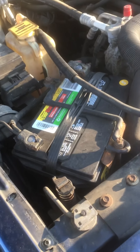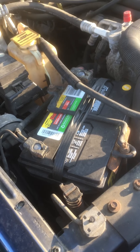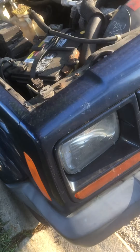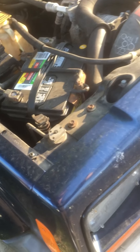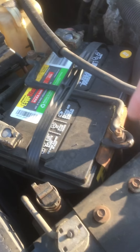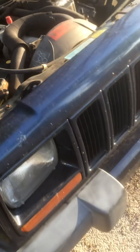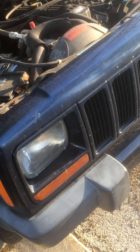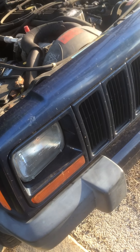The first thing we had to do was fix the battery — the battery had to be replaced. And then this headlight: it wouldn't light up all the way, it was dim. It turns out it was a bad ground. We bypassed the wiring harness — you can't see it with the battery in place — and got a better ground to the headlight. Now it works just fine.